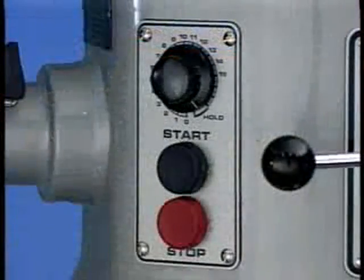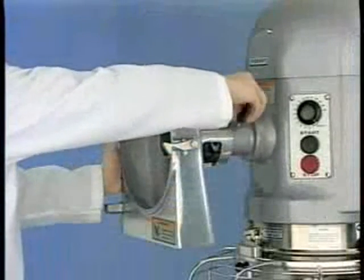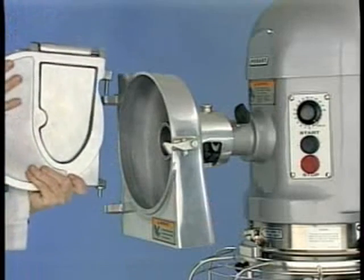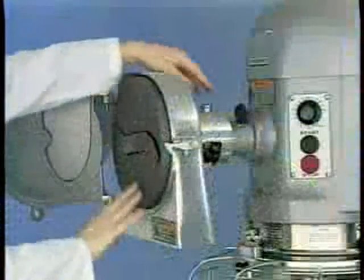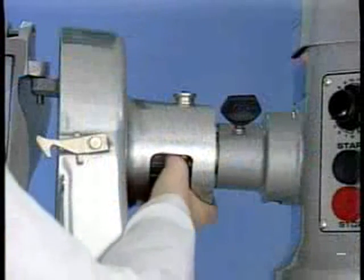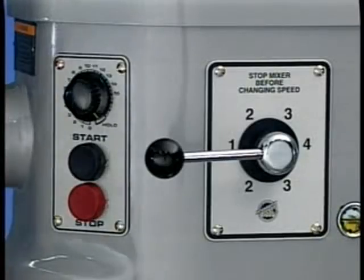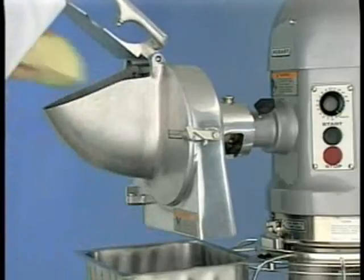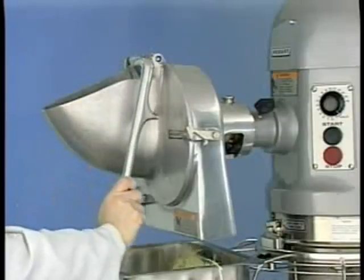To operate the vegetable slicer, stop the power unit — in this case a Hobart H600 mixer. Attach the back case of the slicer to the attachment hub with the thumb screw. Drop the hinge pins of the vegetable slicer into the holes in the bosses of the back case, and select the plate and shaft assembly, such as the slicer plate, to be used. Lift the plunger and insert the plate and shaft assembly into the drive position. Release the plunger. Set the slice adjustment, if used, to proper thickness. Close the vegetable slicer and fasten the latch. Set the speed, then start the machine being used as the power drive. Raise the feed pusher. Keep hands out of the hopper. Place the product to be sliced in the hopper and press down on the feed pusher. Too much pressure crushes the food and causes irregularity in the slices.